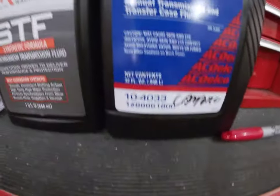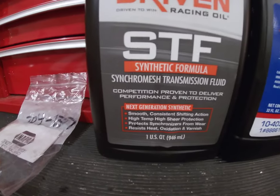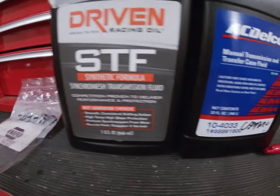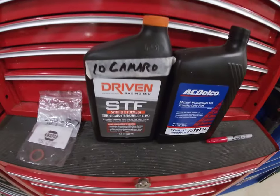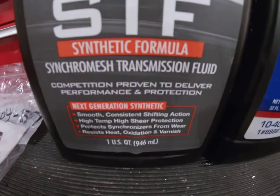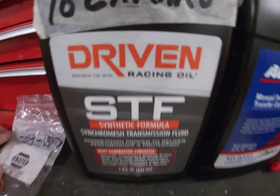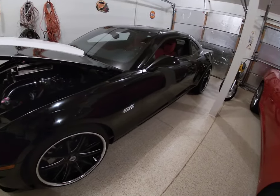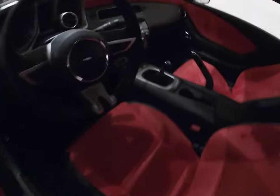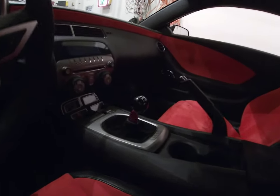The other thing is the fluid. General Motors actually recommends a specific fluid for the Tremec TR6060 — you can call Tremec and that's what they recommend — but I don't like it. I really prefer the Synchromesh. I feel it does a much better job of lubricating. Keep in mind if you're going to the drag strip, you still want to warm up that transmission for at least five minutes before any power shifting. With the Synchromesh I've noticed the smoothness of the shifter is better, and the likelihood of grinding is far less. So if you want a shifter that doesn't grind and is spring-loaded for positive engagement going from second to third, MGW is a great answer.